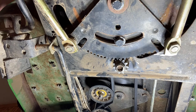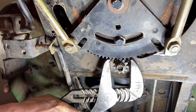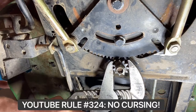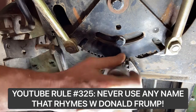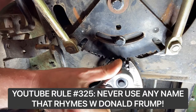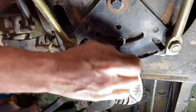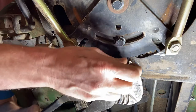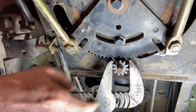If you don't have a super cool impact wrench, you'll still need to get that pinion gear off. What you're going to need to do is hold that shaft while you twist that nut. You can get these big pliers, hold it, then get your three-quarter inch socket and twist it off that way. Or if you have someone around the house, just have them hold the steering wheel up top — that will hold it steady while you get that nut off. A pipe wrench works too, and then it just slides off.